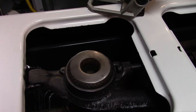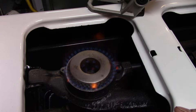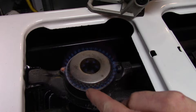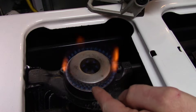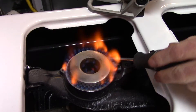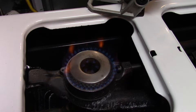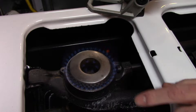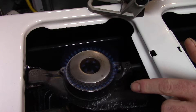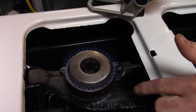So this is the rear burner. As you can see, it lit instantly. I have my nice blue cones. This one's a little extra goopy — getting these little flames going over here — and I blame that on a little bit of garbage still in the burner. It'll burn off after a little while; it just takes a little bit of time. Unfortunately, when I get these sandblasted, it makes it difficult to get the actual sand out of the inner tubes.